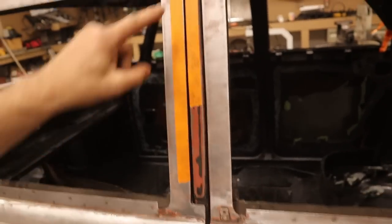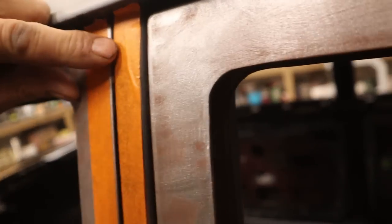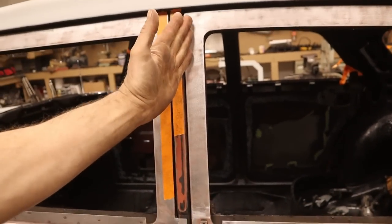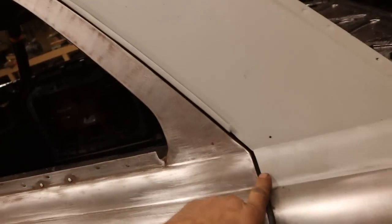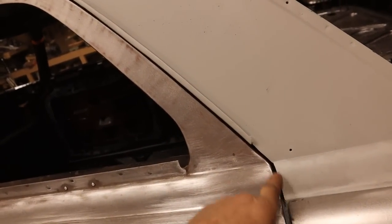If we move that door ahead so that that's not touching, then we have to move this door ahead to keep the gap reasonable. And the gap is already tight here. So if I move that door ahead, then it's this door that's rubbing. Since we're happy here, here, and here, and at the rocker, and this we didn't touch, that's nice.